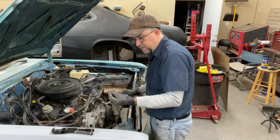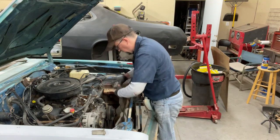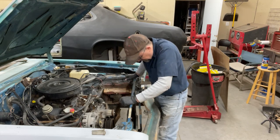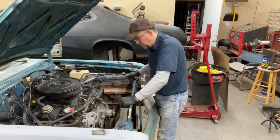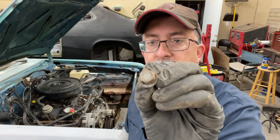There are three bolts holding this bracket to the fender well — why do they have two different sizes? I have no idea. Let's get that lower radiator hose off because as you're lifting the motor out it tends to catch on here. This is some of the junk you find in old cars — this is the bolt that was holding the alternator, with the lock washers all split and spread out. Don't use lock washers on there, you need a flat washer. This is all galled up around the outside, so I'm just going to throw this whole thing away and get a new one.